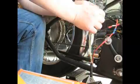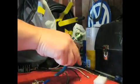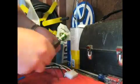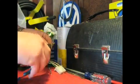The three white wires that come from the regulator rectifier very simply attach to the three white wires coming from your stator rotor assembly. I'm going to unplug everything and get it ready for the terminal connector block, which I purchased from Mike's XS for about three or four dollars — it's an eight-terminal connector. I've got the regulator rectifier on the workbench and I'm clipping on all brand-new terminal connectors, then slowly connecting everything one by one into the white block. When you slide the terminals into the back of the block, you hear a click and you know it's in.